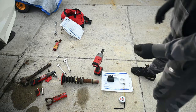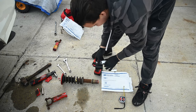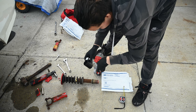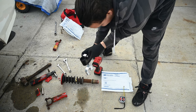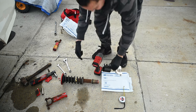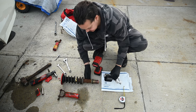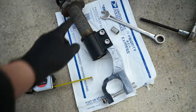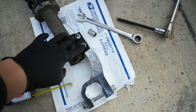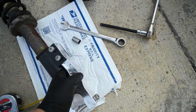One of the nicest parts of the kit is how the coilovers mount. They give you these rear forks, similar to how the front ones are, except instead of a big U-shape it's a little curve, and it mounts to the control arm — this just slides in here. You take your old one off and it threads in place. Then you assemble it by threading the shock into the black body, lock the locking collar, and tighten the 8mm hex cap bolt. It's a 15 on the back.